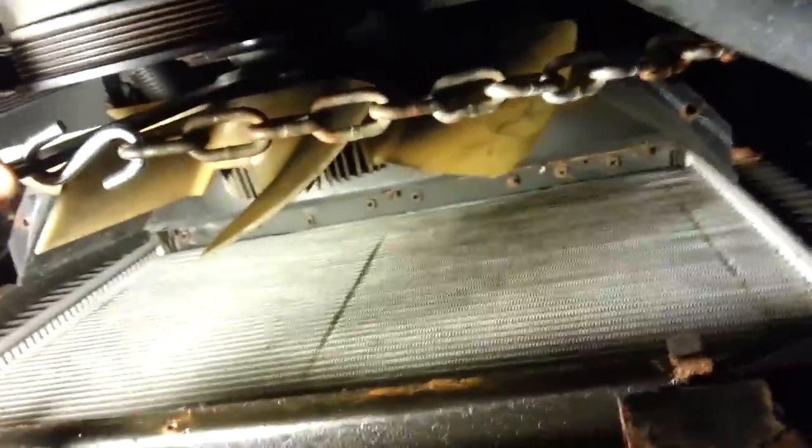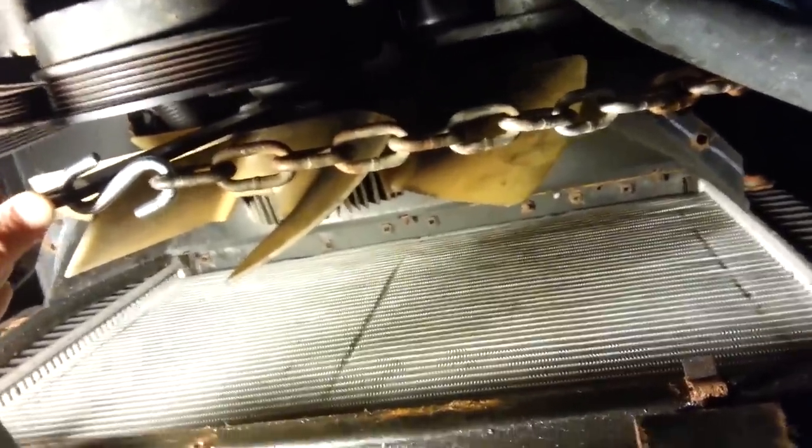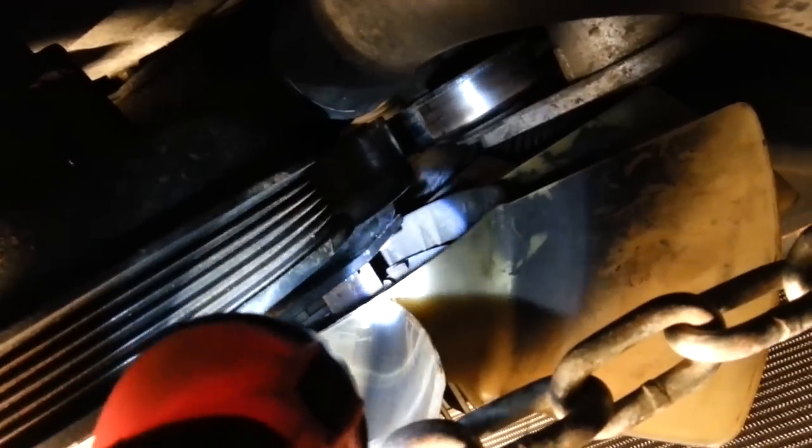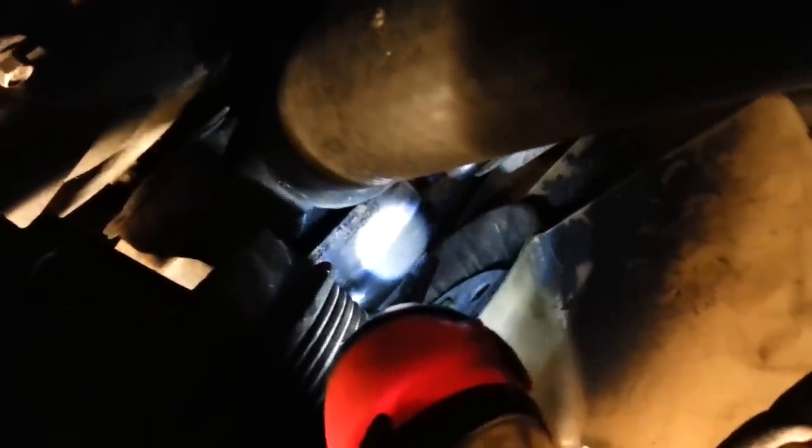This was pretty tight. Sometimes you can get lucky and just use the fan belt — that may create enough friction to get it loose. It takes a 36mm or about an inch and 7/16 wrench to get on that large nut. See that large nut there? That's what you've got to unscrew to get this off, and the clutch and the fan blade will come off together. The problem is the belt is usually not enough friction to hold the smooth pulley — there's hardly anything to get a hold of on the water pump pulley.